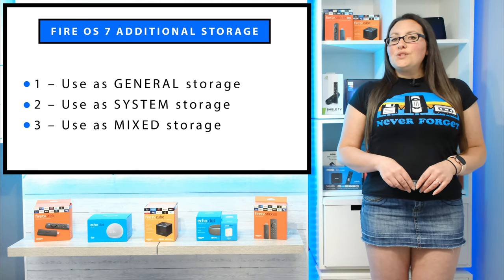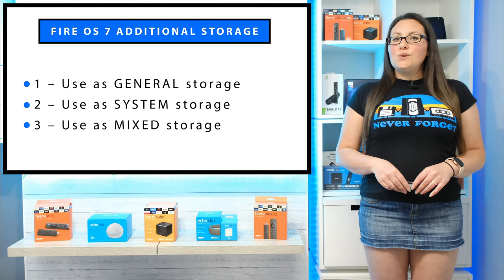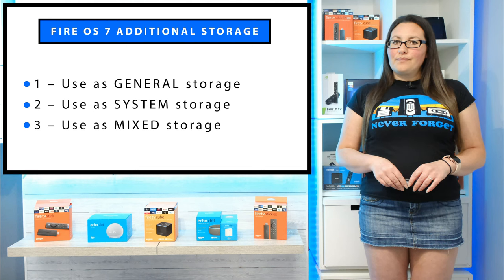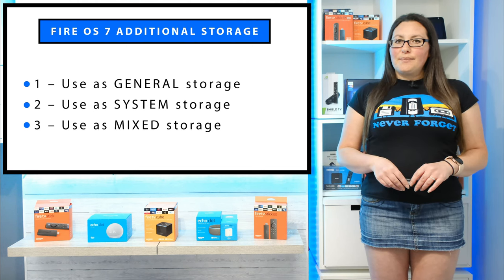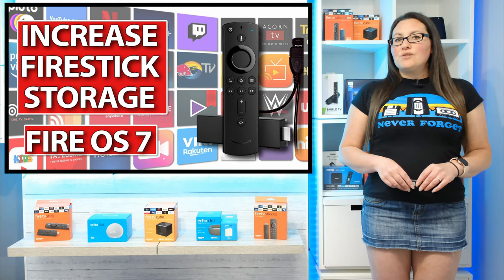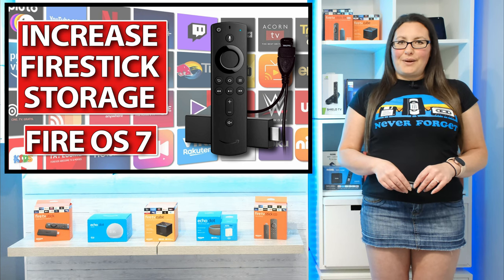Or you can use your storage as a mixed storage drive, so you have a portion of your storage that you can use to install more apps, and a portion of your storage you can access and save files to. In this case, you will need to run an ADB command. If you haven't already done so, you can follow my step-by-step tutorial for adding storage to FireOS 7 Firesticks that is showing in the link above me or in the description down below.